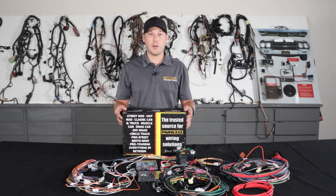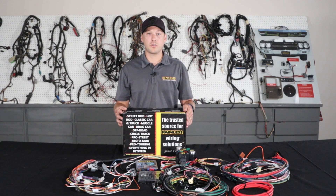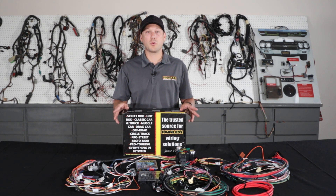It's going to be all bladed fuses. They'll handle all the factory options, and a lot of the harnesses — like the '69 Chevelle — come with a console harness as well. So if you don't have a console and decide to add one, it's easy to plug in the harness later. These harnesses utilize all factory-style connectors and we also print on each wire as well. The installation manual covers everything you're going to need to know and makes it a really easy step-by-step process to install one of these harnesses.